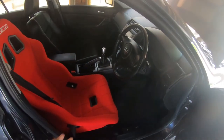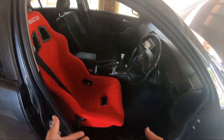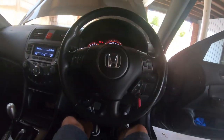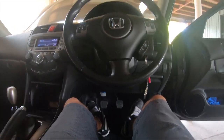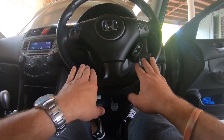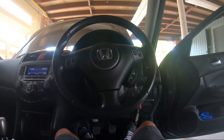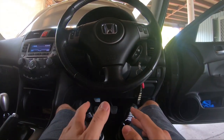The reason I wanted adjusting rails is because these seat bolsters are hard but very easy to damage. With that extra room and being able to slide it back, I can get in without worrying about ruining my bolsters. Safety first — we're nice and secured in, and as you can see there are no airbag lights. That's important: with SRS airbags, when you disable any part of the system it thinks there's a fault, which means your steering wheel — although it might be loaded with a Takata airbag — your side airbags on the car pillars and your passenger airbag won't deploy if there are any errors in the system.